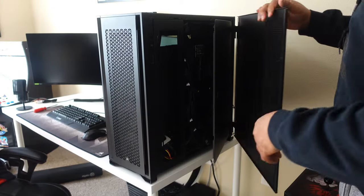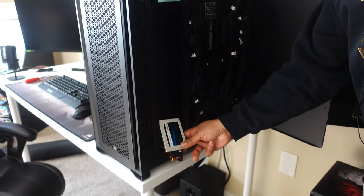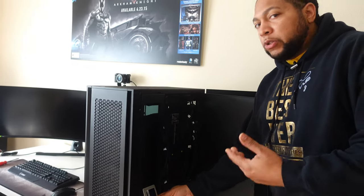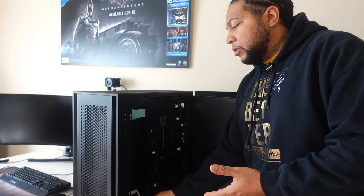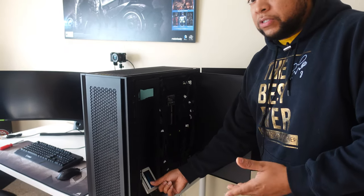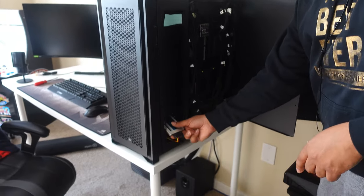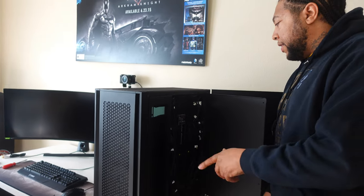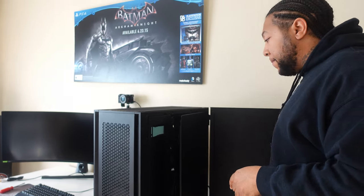I'm going to put my games and load them onto this drive, make it so they work that way. First things first, I'm going to take my drive — I have a solid-state drive. If you're using a mechanical drive, by the way, this thing can take up to 2 terabytes. I won't say it's pointless to get a 2 terabyte — I do have the entire collection of PlayStation 2 games, though you can't fit them all. This 275-gig solid-state drive has the power and data cable plugged to it. Next we're going to go to the computer and get this drive formatted.